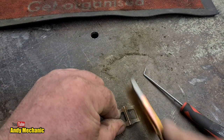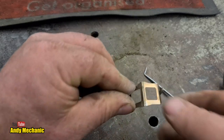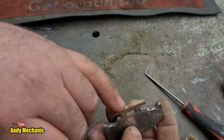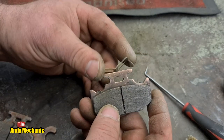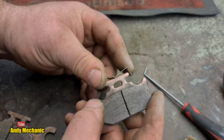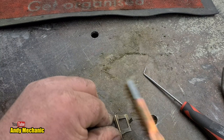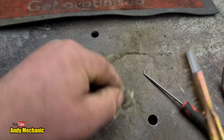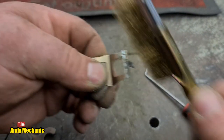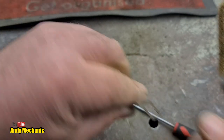It's always a good idea to give this spring plate a bit of a clean while it's out - it doesn't take a second. This is what it is - it stops the pads from rattling. It sits against that little groove on the top and pushes the pads down in the caliper body, stops them rattling around, which helps cut down on vibration and squeaks from the brakes. So this is important. There are only two calipers on this bike - it's not like you've got four to do on some quad bikes. Nice and clean.